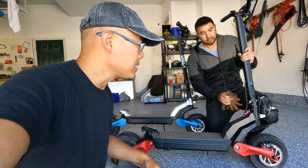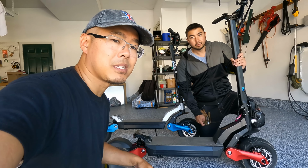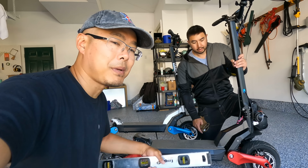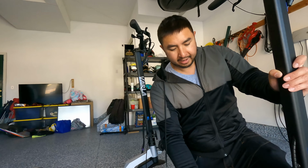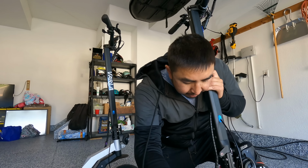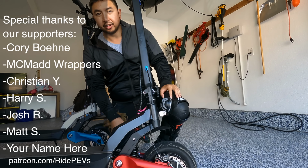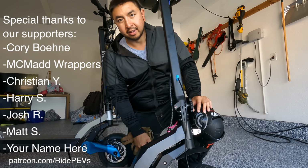And then the other option is the whole design is the same. They just tighten some stuff up and now it just feels better. I'm not sure why there's less wobble. I think it's probably the suspension coil. They've probably tightened down on the resistance. So you can tighten down the top of that to make it have less spring action. And that's probably what they did to stabilize it at higher speeds.